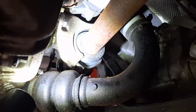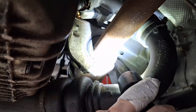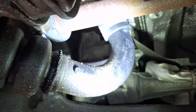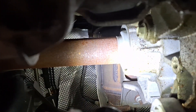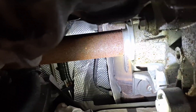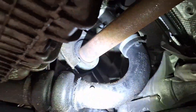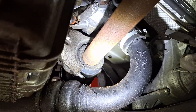They are bad about the axle bearings failing and damaging the axle bracket. I've actually seen them get so bad where they come out of that bearing support. I've seen them back out of there and the splines will damage the differential in the transmission. It can also cause fluid loss and catastrophic transmission damage. So go ahead and peek under here if you have the two-wheel drive.